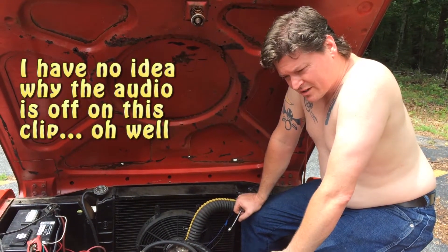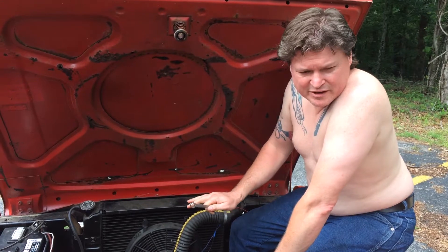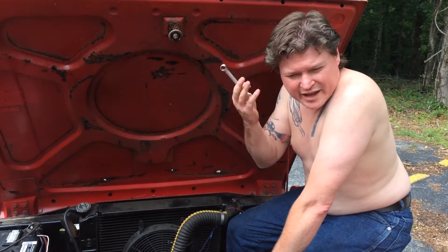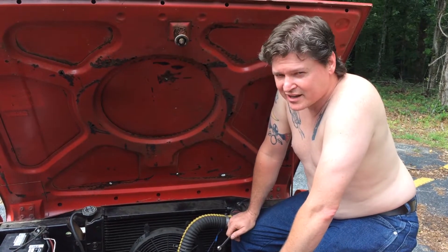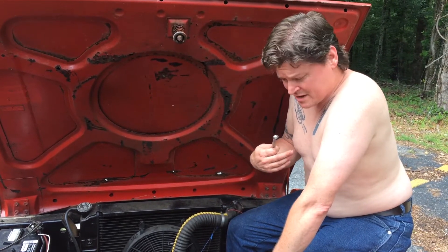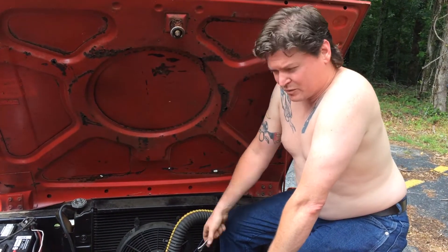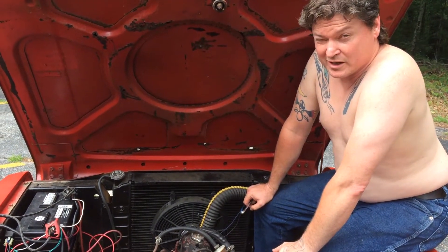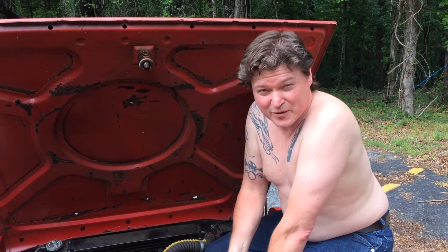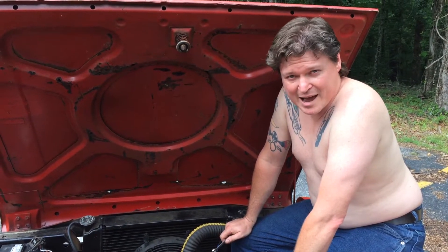My brother — I was going to give him a shout-out. He told me the right things to do. I've timed a vehicle before but not without a manual, so I had to call him and ask how to do it again. He told me graciously, and props to me too — I was able to describe what was going on. The vehicle was really hard-starting and dragging. He said, 'I bet that rotor button is one tooth off.' Well, I got it to fire up and run pretty good, but I'm completely out of adjustment up against the engine and need to adjust a little more.